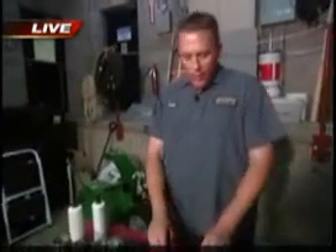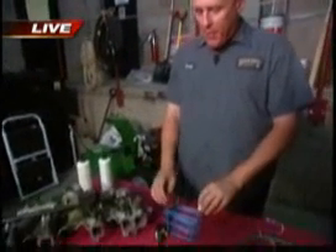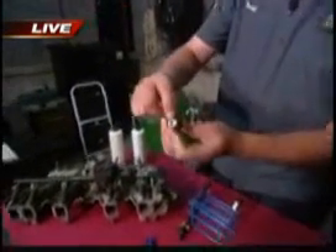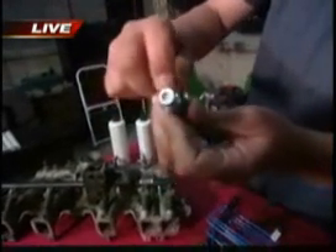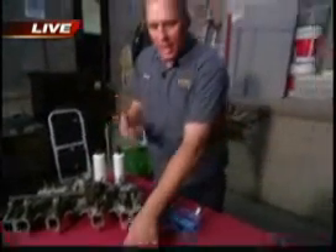With fuel samples, when they should look like this clean spray, so many more of them are looking like the gunky version. We have to think about what happens inside that little injector — it works just like a hairspray bottle, the fuel sprays right out like I showed you in the picture. If it's coming out in globs or blobs, it's going to run down the sides, make a mess, and not ignite well.